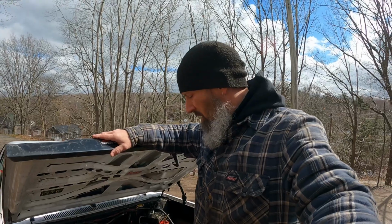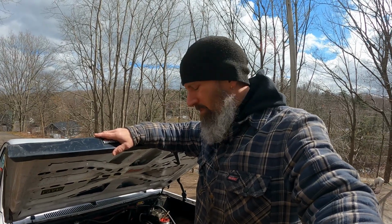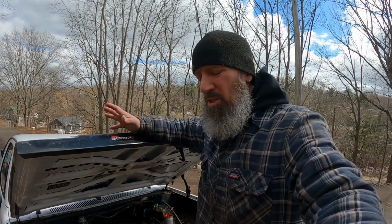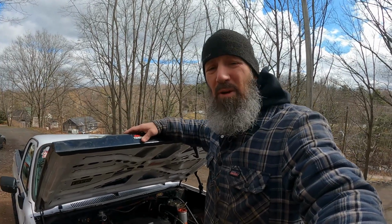All right, you guys, I'm not sure what the deal is with the squealing. I'll have to look into it, but we'll get it figured out. But that's one more thing off the list. The alternator did need to be changed because the bearing was starting to get bad. Just an update before I end off this video, let you know what the deal is with the belt squeal. As you saw while we were driving it, it was still there. I assumed it was something to do with just the belt and the belt only because all the rest of the components of the accessory drive are good to go.